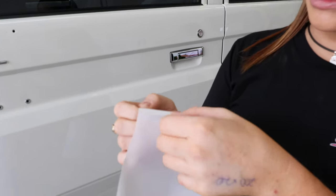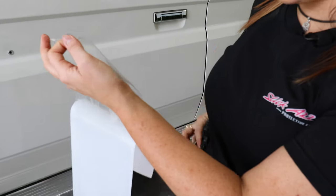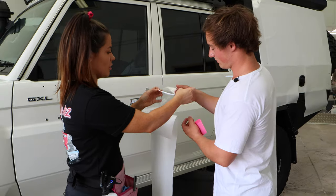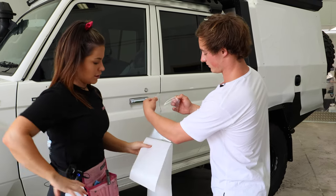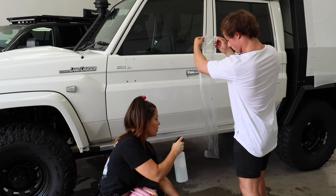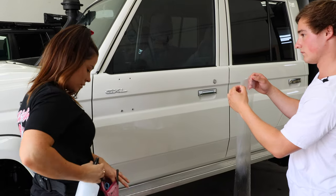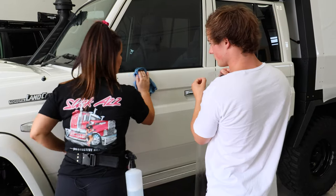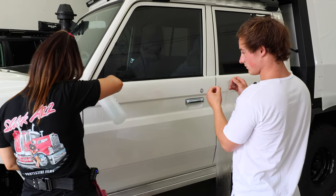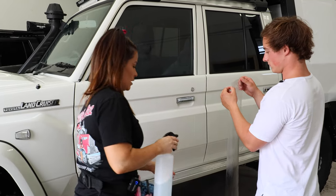The shiny bit is your film - this is your top side and under here is what I'm talking about - it's really sticky. You've got to make sure you spray that before you touch it with your fingers, because otherwise you will get fingerprints in the film. Hold the top of that piece just on those corners. If you're doing this at home with someone, you need to pull the backing sheet down. If you pull the film up, that's going to be the easiest way to remove the film off the backing. Now I'm going to spray my panel. I recommend that you wipe each section just before you go to install, so there's no chance for any dust to settle. If you see any fibers, flush it off.